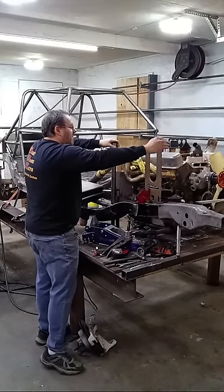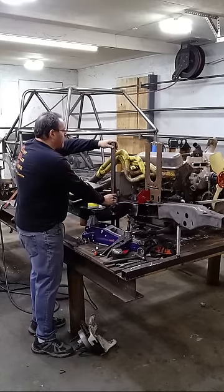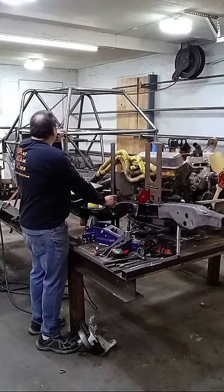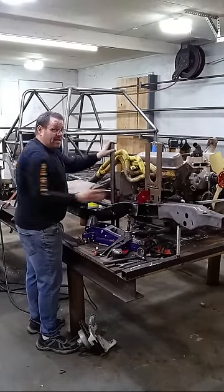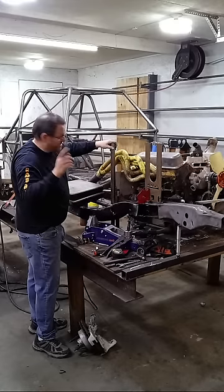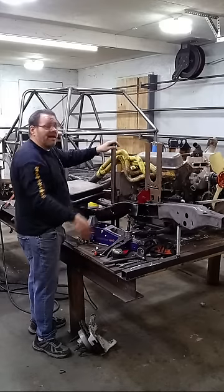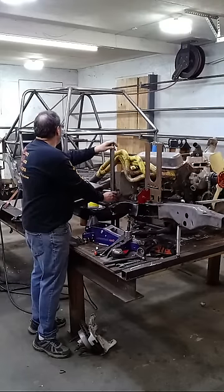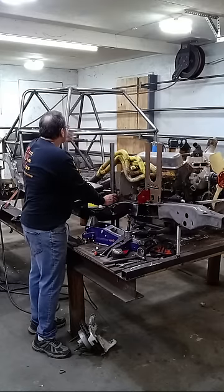But anyway, if I come back to this and then butt into that node, that may be better because I know I'm going to have a V coming out of the center right here. And if I do one tube and bend it here and then bend it there, the bends are going to be tough to figure out because it's bends on two different planes. Chris, you'll know exactly how tough that is because you do them. But if you do two different bends on two different planes, that's tough. Now, I know how to do it. You use this tube to cheat to do it. But it would be easier if this came into a node and then I could turn around and take a straight tube off the center because I want to have the W.